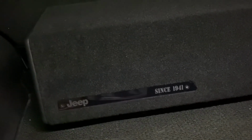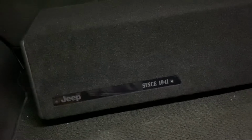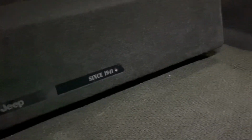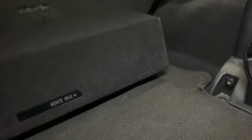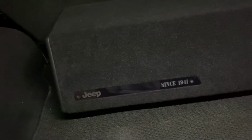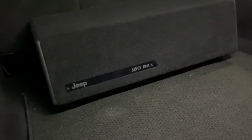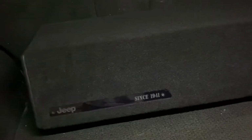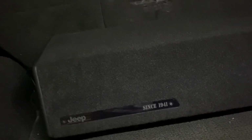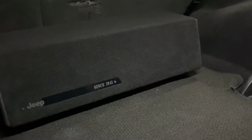And also the subwoofer amplifier that was in here, he had an Alpine M100, which is a 1000 watt amplifier at 2 ohms. That ended up not working, so the bass that he was getting was coming out of the factory subwoofer, so that's been disconnected and replaced the subwoofer amplifier with a Soundigital 1200.1 Evo, which is now powering both 10-inch subwoofers. So yeah, and the other amplifier is a Hybrid Audio Technologies 4-channel and Hybrid Audio Technologies Unity speakers up front and Mirrors V speakers in the rear soundbar.